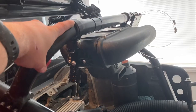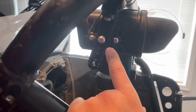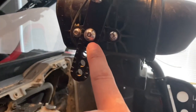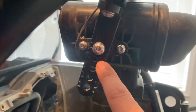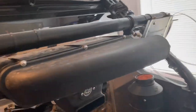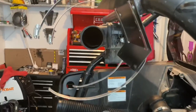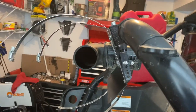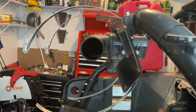One thing with the spare tire mount: it's barely wide enough to work, and there's quite a bit of alignment to do. You'll see how I have it set up using the first hole, and I'm coming in at an angle because you have to perfectly align the outlet of the particle separator to go into the filter housing. When you come to the other side, it has to be perfect.